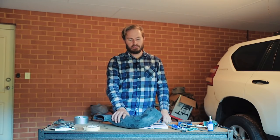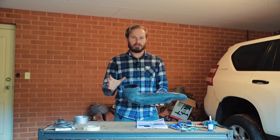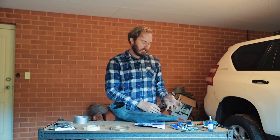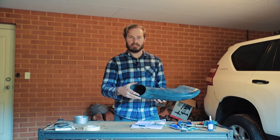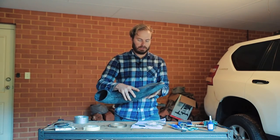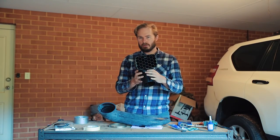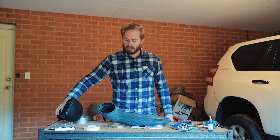The afternoon grows late but we're tracking along. This is the next step — the connecting pipe between the snorkel on that end and the airbox on that end. I can't show you this on camera because it all happens behind the guard and it's too tight up in there. But this gigantic hose clamp — got to elongate that a bit, just squash it down and that'll slip over the end. Then there's this one that goes over this end to go to the airbox. Get the hose clamp over it first, then slip that over the snorkel end, and then weasel that through the hole in the inner guard. Also down here, the snorkel head — we'll pop that on. They give you a nice neat looking black hose clamp to lock that onto the top.